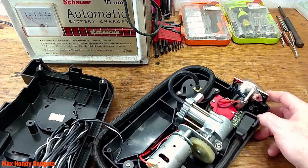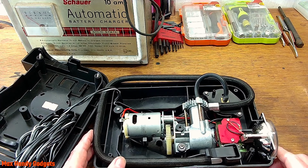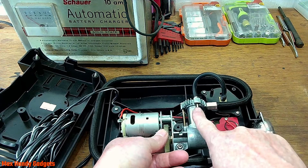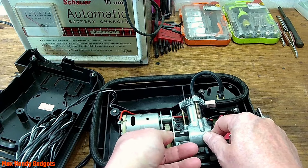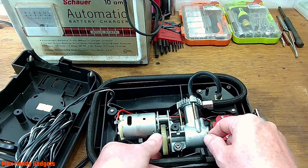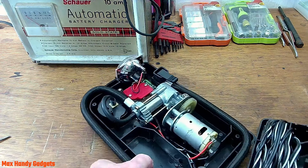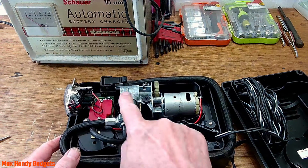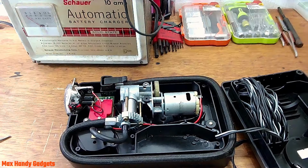It's pretty simple. Let me turn it so you can see it better. Okay. Yep, it looks like the gear here is supposed to turn and move a pump cylinder. Oh, and it's jamming. It's not going all the way around. It's jamming, so only goes halfway. Okay, well, let's spin this around. And it looks like we're going to have to take this pump out and take it all apart. Okay, it's a mechanical issue, not a wiring issue.